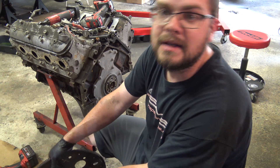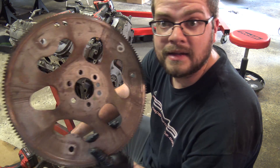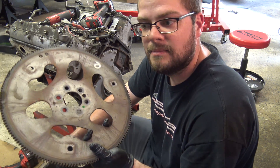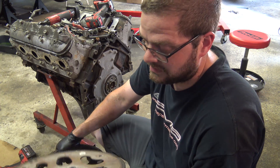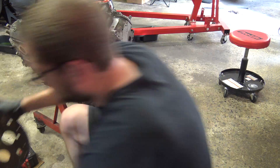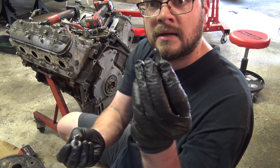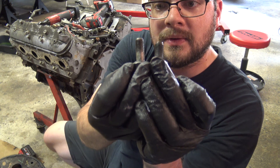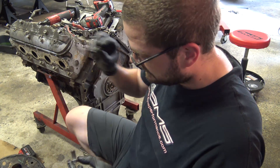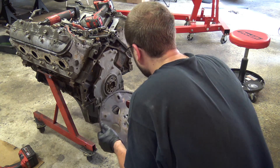Also, if it's hard for you to find 80E flex plates and you have 10 of these laying around, just get a converter that fits a 60E flex plate with an 80E back end, then you don't have to worry about getting flex plates. You're wasting money — like 80 to 100 bucks on a stock flex plate. You don't need to do that. The 60E flex plate bolt and 80E flex plate bolt — the 80E's is longer because of the spacer. So, hopefully that helps you understand all that.